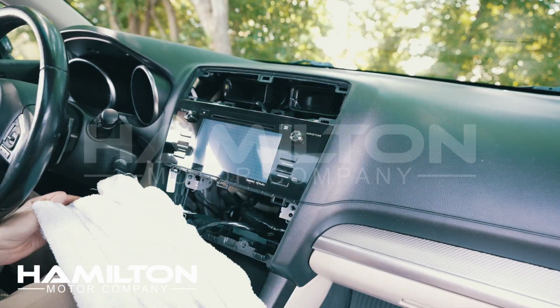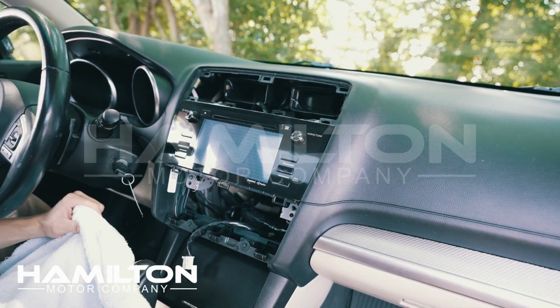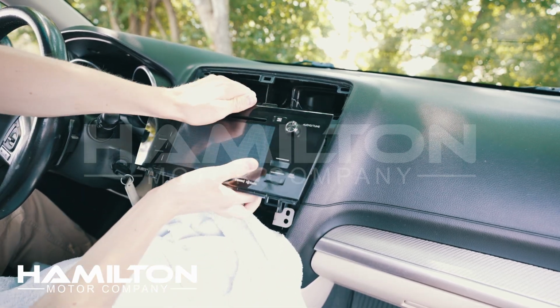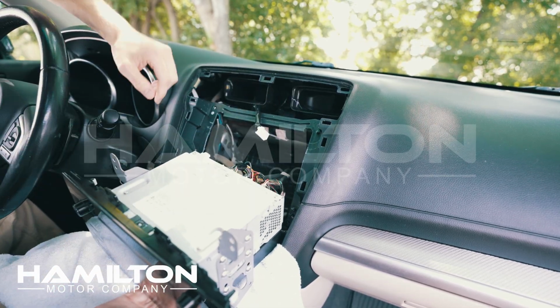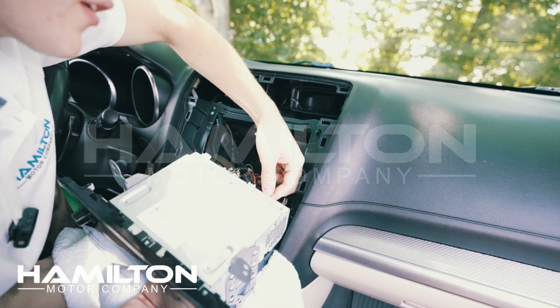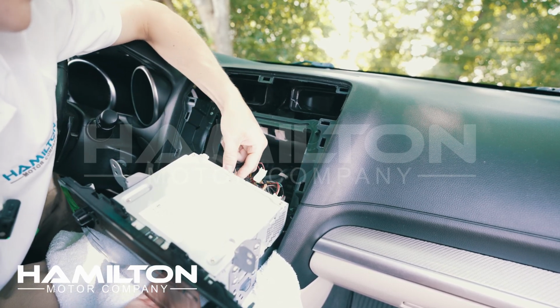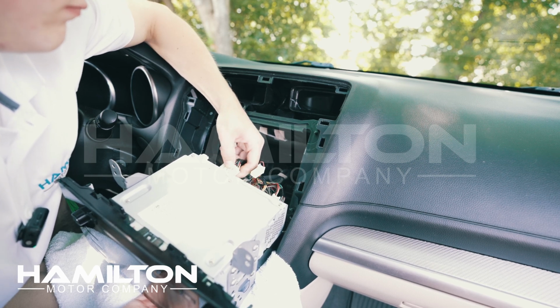With the 4 screws removed, let's take a towel or a blanket. Make sure you protect your center console. We'll pop the radio directly out and we'll set it here. You can now disconnect every harness behind the factory radio. Press down on the tabs one by one and slide them out.